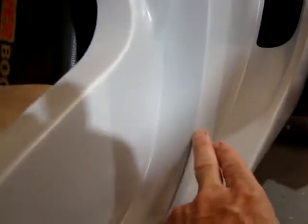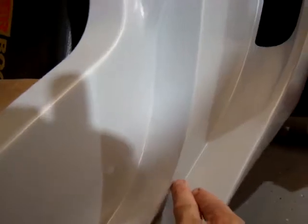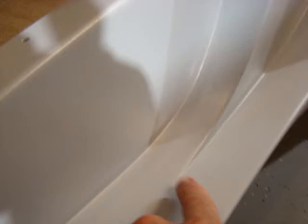so that's that. Here's these lines again, some of the more important lines. This is the one that your door panel will align with once your door is closed. And so the transition that I showed you down through here is real important, that you don't sand that out and make it disappear. So you really want to be gentle with the sanding block. When you've got a lot to remove, use a lower grit, and then as you get up into these areas, you may want to switch up to 220 or higher as you start blending down into the body.